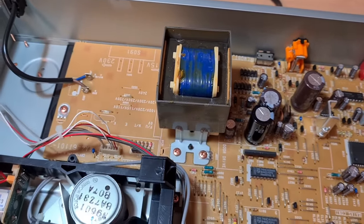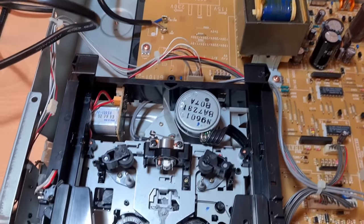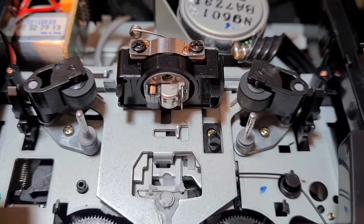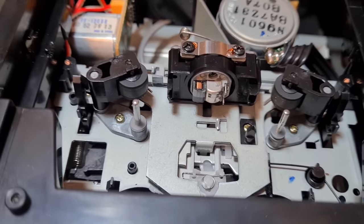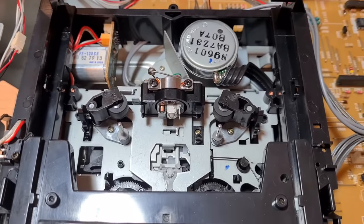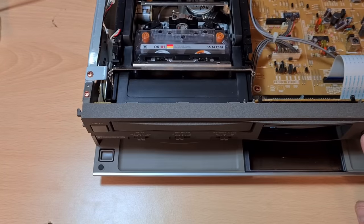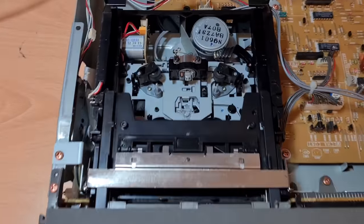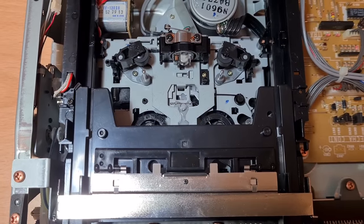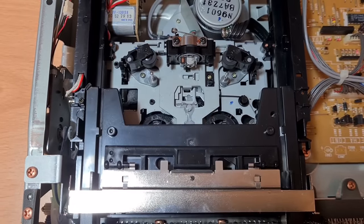Caps and transistors as expected, and a fairly average-looking power supply - it even gives you a 115 and 230 volt switchover. For the purposes of looking at the transport, this thing is clean and quite nice to look at. Pinch rollers look good. I'm going to have a play with the drawer and see what it does when it shuts and what engages. It's sucking the tape in into position, but it sounds like there's a drive belt that's come off underneath - just the motor spinning. So this transport is going to have to come out.